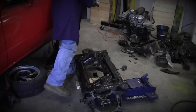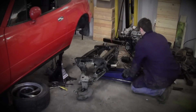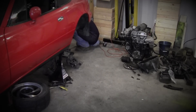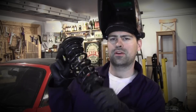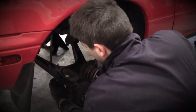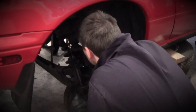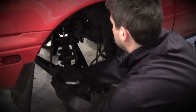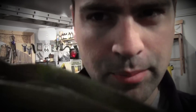I just finished reassembling my first rear strut for the Miata. The installation manual of the Monster Miata conversion kit tells you to use your front spring, cut one full coil off of it, and then install that spring on the back.